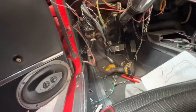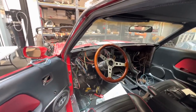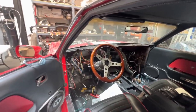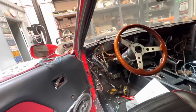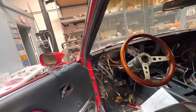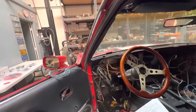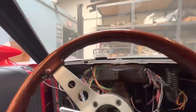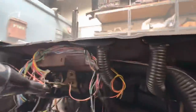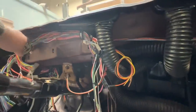Little tech tip: it's a lot easier to put all the fuses and relays in before you mount it to the firewall — it's a little bit of a pain to get to but that's where it's designed to go. I use a couple of adels and an oversized adel to run the harness above the steering column so when the dash goes back in there's enough room. The adels aren't so tight that they're choking the wire — there's enough room to run some extra wires. Once all said and done, I'll zip them up.